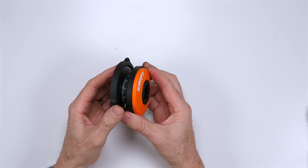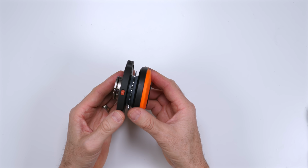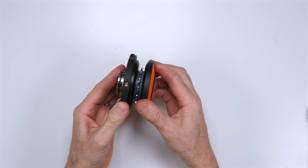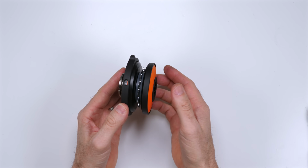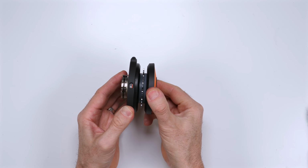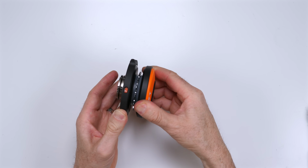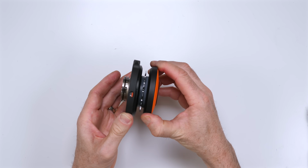Now, there's a lot that goes into this, and when I first saw it, I was quite impressed. Okay, the first difference here is that it has a manual adjustment of 10 different positions, and each click moves the COG out 0.6 of a millimeter. So with 10 positions, you get 6 millimeters of adjustment, and you can pretty much see that moving out, and the last click, 10, and so you can just keep moving it like so, without having to wind it forward and back.